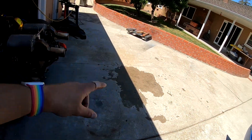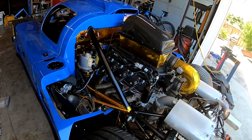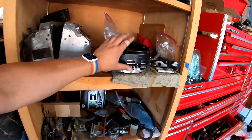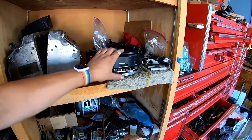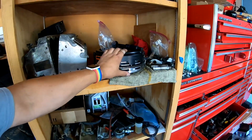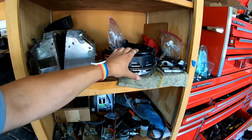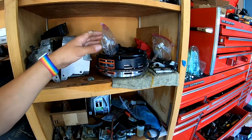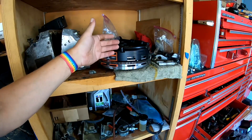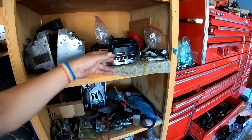On to some of the fun and disasters, trials and tribulations over the past six days. In one of the previous videos I showed you the nice triple plate clutch from RPS. Unfortunately, we could not get this in the car successfully. We tried for three days, had the transmission in and out of the car about a half dozen times, and through my mistakes and fatigue, we could get it through two plates, but we could never get the input shaft of the transmission through the third plate on the clutch.